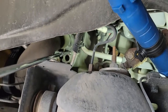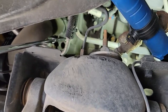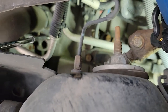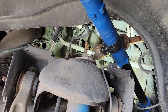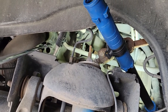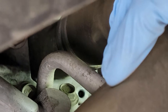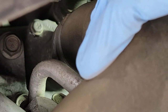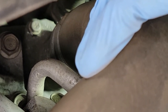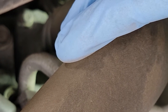We're going to go ahead and move on up here to the thermostat housing. I just used a quarter inch ratchet with a long extension and a secondary long extension, basically getting way back in there. It won't focus because I can't get past the top of the strut housing, so we'll get that out and then work on getting to the next bolt. There are two bolts for that and they're both 10 millimeter. From the left side you can see the bolt that's highlighted there next to the big one on the right — that's your top one. I was able to come up there and hit that one with the swivel and two long quarter inch extensions.